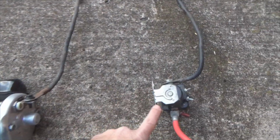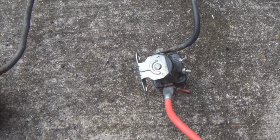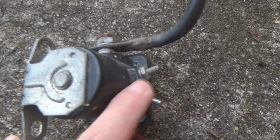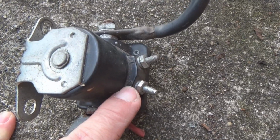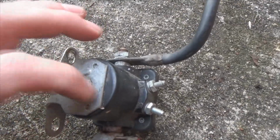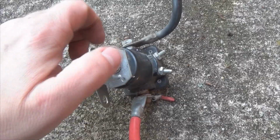Now, as I just mentioned, this is your starter solenoid. This wire right here is going to go on the positive side of your battery. This will be your ground. When you bolt this to the side of your firewall, your fender, wherever the case may be, this will become your ground. And if you look real close, you've got an S and an I. Some Ford solenoids do not have that I, so it's irrelevant, because the post we'll worry about here is the S. This is the starting circuit, which means when I turn my ignition key, it activates this solenoid post. And if you refer back to my relay videos, this is very similar. When the current hits that S post, it closes the coil inside here, which allows voltage to pass from here to here, going all the way around, spinning the starter over, because the starter bolts to the block, which has this ground there. So this allows current from the positive side of the battery to flow through to this. This is your ground, completing the circuit, starter spins over, okay? Now we'll get to the Jeep circuit here in just a moment. So let me explain how the starter button is going to work.